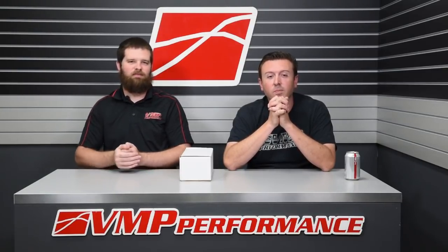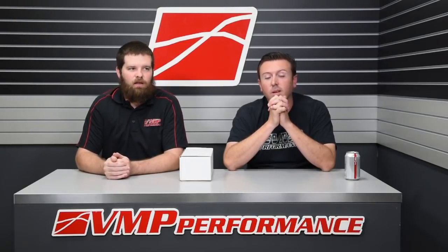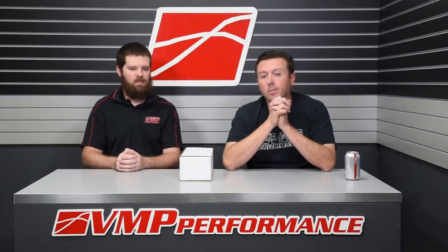B Lightning says my brother has a 17 2.7. What should the first mods be to improve performance? Good quality fuel, step 1. I'd say an intercooler upgrade is step 2, and then step 3, tune, or even steps 2 and 3, do the intercooler and tune. And then I see a lot of guys doing oil separators on those to keep the condensation out of the intercooler from going into the engine. I know Mike has basically all those on his 3.5 truck. And then maybe intakes for the turbos.